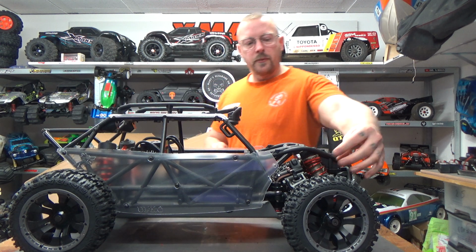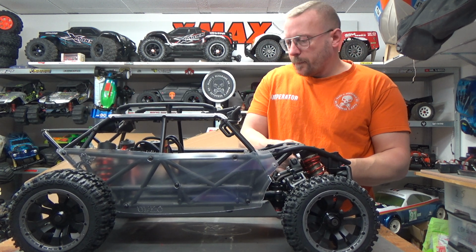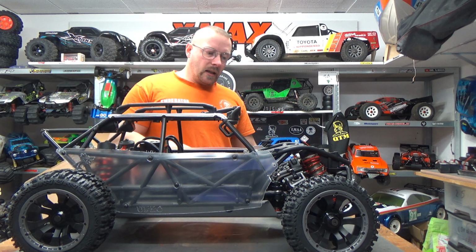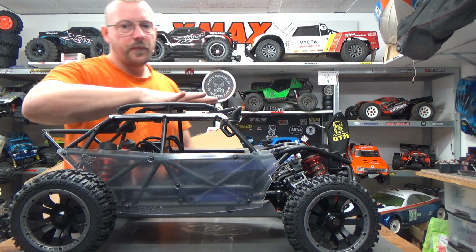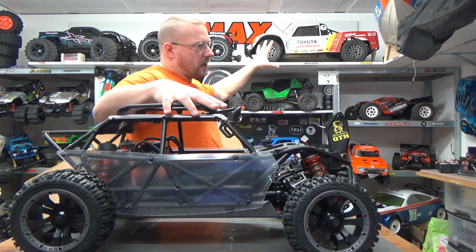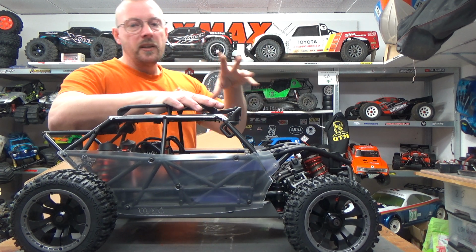I will turn up my suspension pressure here, my shock spring pressure, to see what happens with this stock suspension. I'm gonna order the 2 servos once I see what size of servo I can use for it, and finally drive. Because before I do all that, this is my truck. I have many tests to do on the 5T. Don't forget, I use the 5T at 20 kilograms for the setup. The Reminator will be 40 kilograms.